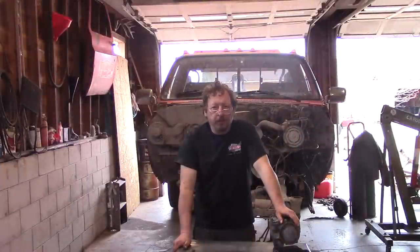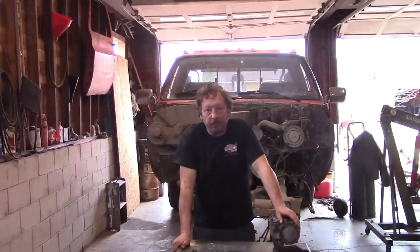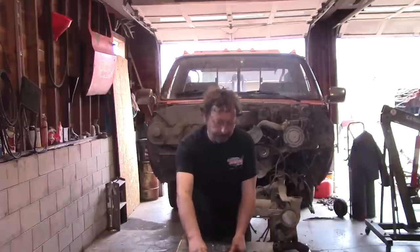Now that we've got the frame back to where it should be, it's time to put our steering back together. A lot of you have been commenting about upgrading to crossover steering and some sort of rock ram assist. While I would love to do that and it is on the list, my pockets aren't quite that deep just yet, so we're going to put it back together with the push-pull drag link for now. But we are going to reinforce it a little bit — I have one of the off-road design steering box brace kits that we will be installing, and we're going to reinforce the bottom flange of that frame. Thanks for watching VSF Recovery Team. Keep wheeling, stay safe. Subscribe to this channel and maybe we'll see you out there in the woods.